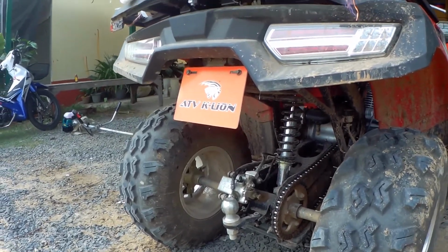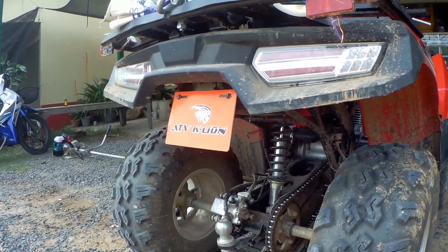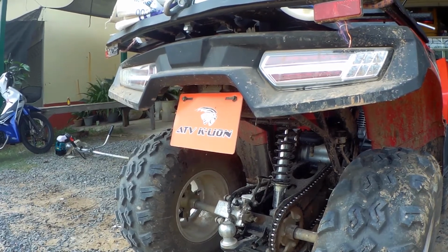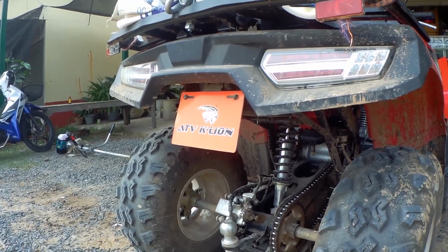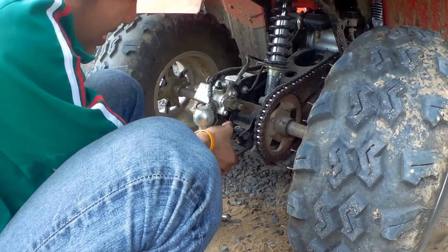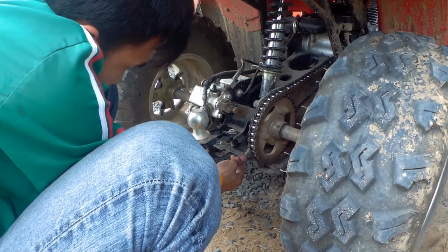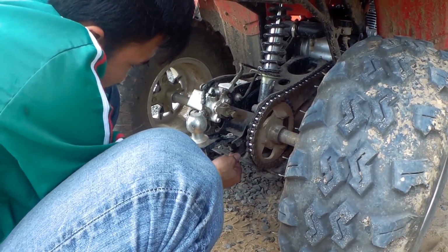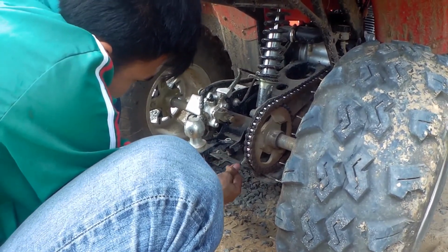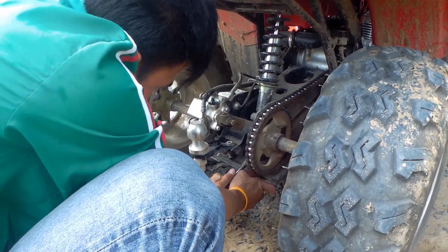I don't know why they mess about. If you go and get yourself a socket set, you'll get on it, because you've got the spacers on the sprocket carrier there, and the same on the disc brake on the other side. You get in no problem. Even another spanner for a bit of extra leverage there. At least he's not trying it with the open end and jug, rounding it off.